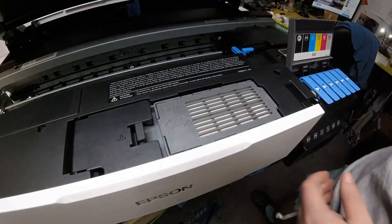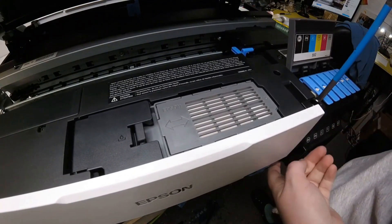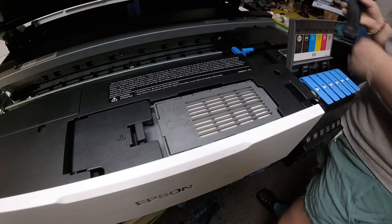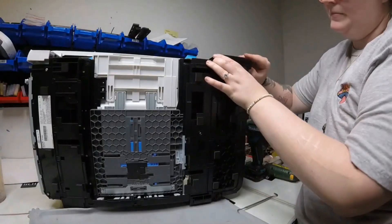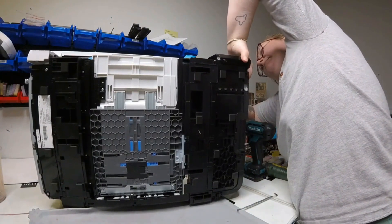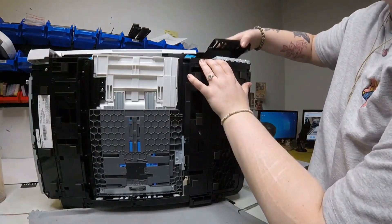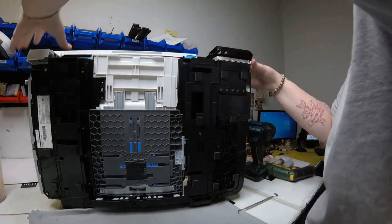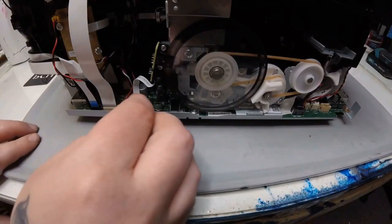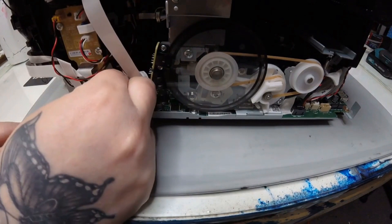On this side, you'll see a gray area — take the screw out. We're on the top of the printer now, opening up that gray cover where the ink is. There are going to be two screws up there — take those out. Now we have the printer flipped over on its back so it's sitting upwards. This is where we pry these tabs on the bottom and lift off the front panel. The front panel comes off because we disconnected the two FFC cables and the white cable.